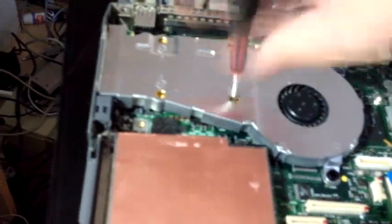So that's the laptop opened. Next thing that needs to happen is this heat sink needs to come off, which means these five screws need undone. Now we're at the meat and daddies of the operation. I'm just going to get a flat-headed screwdriver to open the CPU socket.